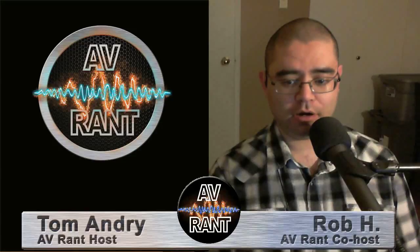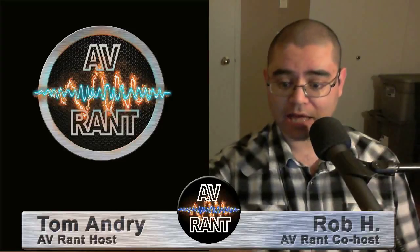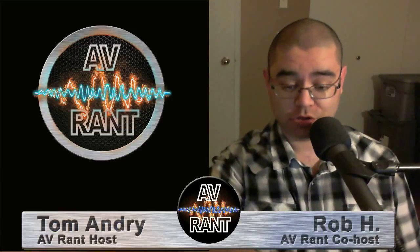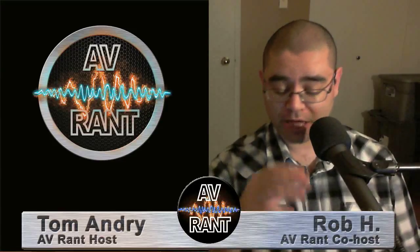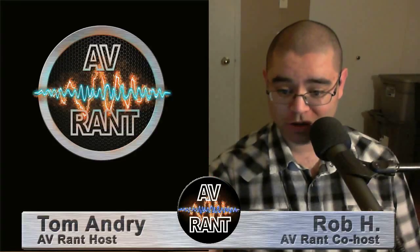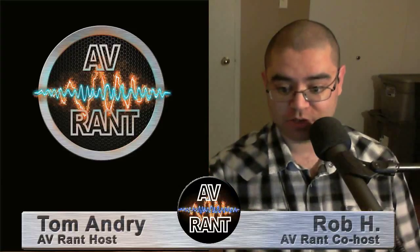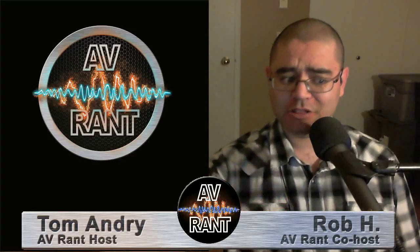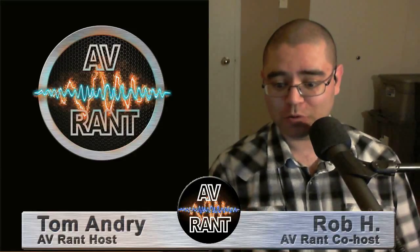Honestly, what a lot of pro calibrators are doing right now is sticking with calibrating a standard dynamic range Rec 709 color setting. For that, you can still just use the Blu-ray setup disc, the Spears and Munsell or Digital Video Essentials. And for HDR, largely even professional calibrators are just leaving it alone. They're making sure that if there are different HDR settings, they're going for the HDR standard setting, because a lot of them offer an HDR vivid mode and you don't want to use that. That might be the default. But other than switching it to the HDR standard mode, that's about what most pro calibrators are doing at this point.